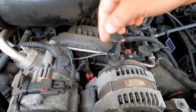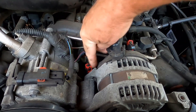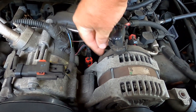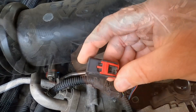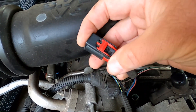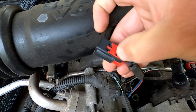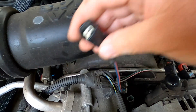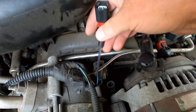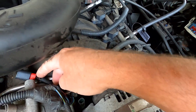We've got this press-on connector which you should be familiar with — press the black tab in and just lift it up. So I've got the connector pulled off. Always look inside and inspect your connections to make sure they're fine. There's a little black tab you press down to pull up. You want to take an air compressor and blow around it to make sure there's no crud before you remove the old temp sensor.